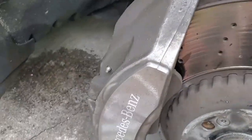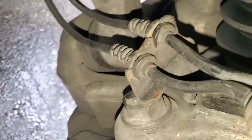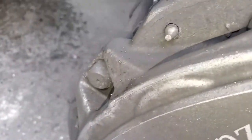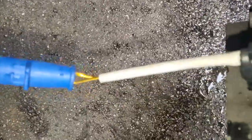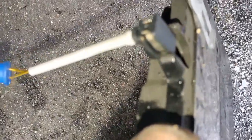Now we are on the passenger side of the brakes. A few things that are different: now we have a sensor which actually goes into the brake pad itself — it goes into this little hole right there. In the back there's a special bolt — it's called a star socket, E10. We need the tool to actually take it off. Let me show you what the sensor actually looks like. You can basically just come here and pull the sensor right out. If you had to change the sensor, the new sensor would go into that little slot. If you were to change the sensor, this is the position — it will actually go into that hole and you would push it down into the slot. And of course where I showed you where this pulls out — that's basically changing the sensor on the brake pad.